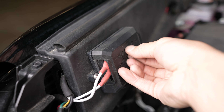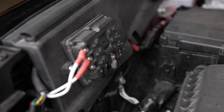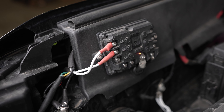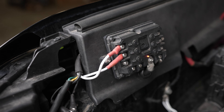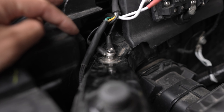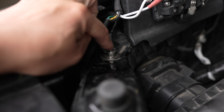This cover has a little latch that comes off — twist that, pull the cover off just like that. Inside, we'll expose six terminals where you guys can attach your accessories, whether it be lights, an air compressor, a fridge, anything you want. All you have to do is run the positive to one of these terminals and then your negative — which is your ground — to any ground on the vehicle. We cleaned up this area a little bit to remove some of the paint, put a bolt there, and made that our ground.